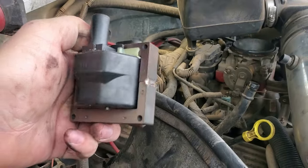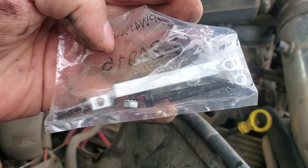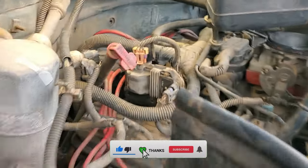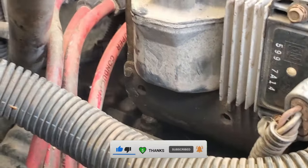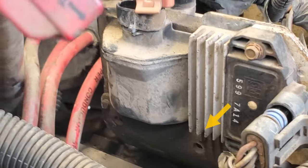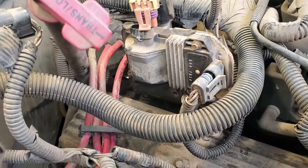So when you purchase your new coil it's gonna come with a little bit of hardware. This hardware is because this coil is riveted on. You see these bottom holes down here? Well, on that plate on the truck, you cannot unscrew that. There's a pin right there and another one matching on the other side — you can't remove that just by simply unscrewing it.